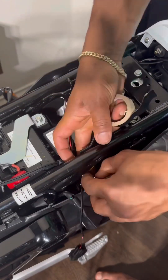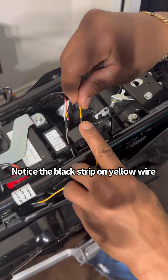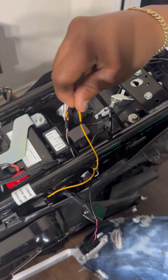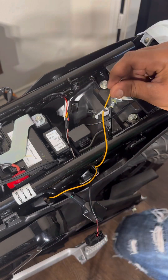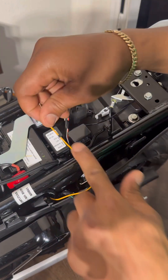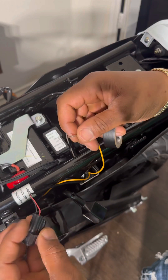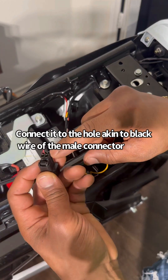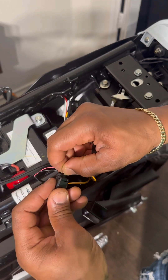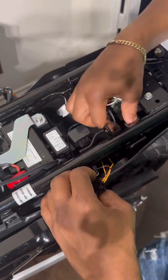Now we're going to put the four screws back in. We've got all the wires threaded through, everything is looking nice, clean, and professional. That black wire with the black strip — that is very important. It is going to go right next to the ground wire of the male adapter plug for the flasher. It snaps in — if you mess it up, you're going to have to try to get it out. I could have just cut the wire and reconnected it, but that would look tacky and can cause problems in the future, so I figured out how to get that plug out instead. Really pay attention to this part.